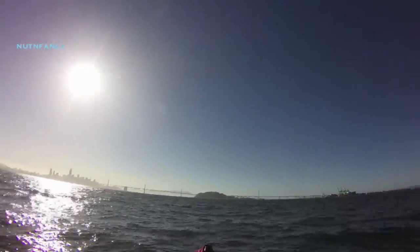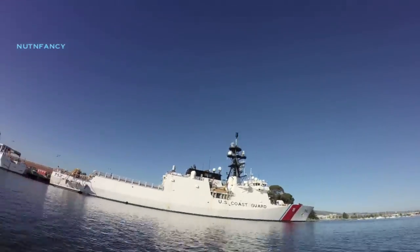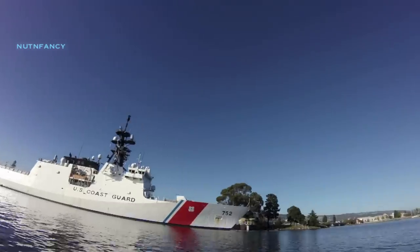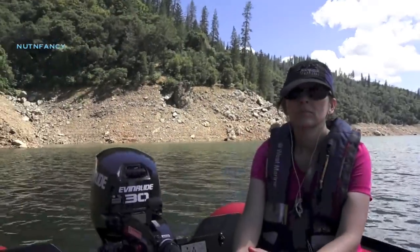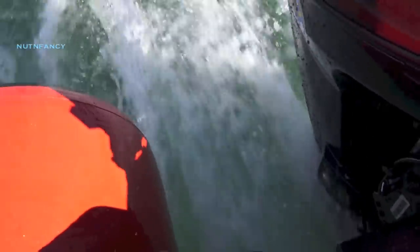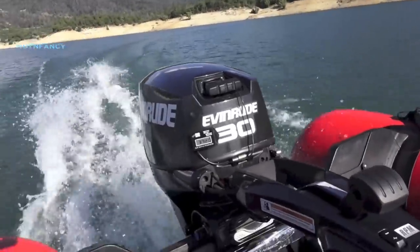It's pretty cool. The Evinrude E-TEC 30 is an oil-injected motor. There is a container underneath the cowling that I just keep filled with oil. It doesn't go through very much oil. It's very minimal, and I like that because it's a 4-star EPA rated, so there's no oil into the water. On this body of water, for instance, it would be illegal to bring any old 2-stroke motor in here because it leaves an oil slick. This one's clean. It's EPA rated, it's totally clean, and I love it. I don't have to change the oil on it, so it's less maintenance overall. But I would probably put at least a 30 horsepower on it for performance.